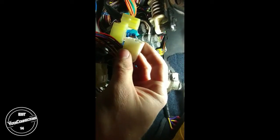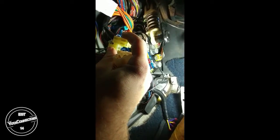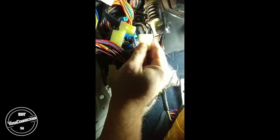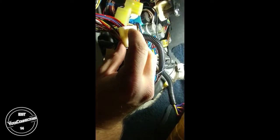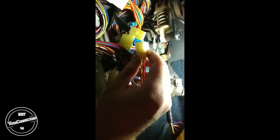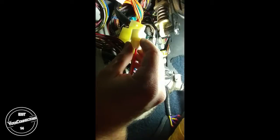Now the reasoning behind this is that since this connector does not have any type of latching mechanism, you need friction to hold this together. So what you'll notice when you push it on, you'll see some stress marks forming on the center of this. That's completely normal. Now the material of this connector I thought was going to be different from the manufacturer. This one does show the stress marks a bit more than my prototype did. However, it will stay on there. It shouldn't crack. If it does, just send me a message and we'll try to get it sorted. But even if it does crack, there's really no reason that it shouldn't keep on working for many years.